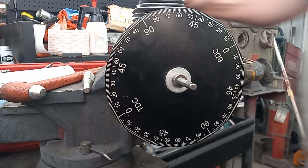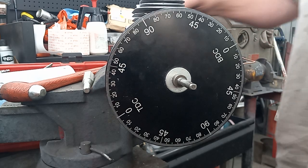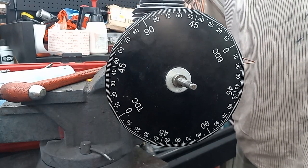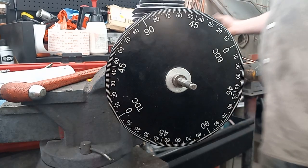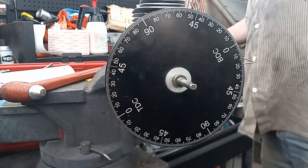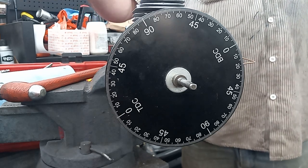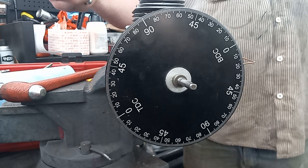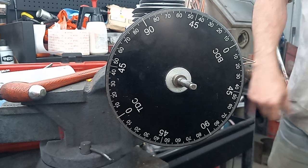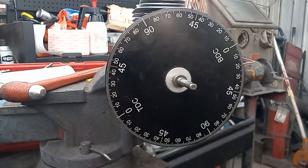But on a wheel, typically I like to look in here and roll the saw all the way down to bottom dead center, because it'll start getting you close. You can use a thread-in piston stop. I know I got some somewhere, they come with these things. Believe it or not, I'll typically use a 5/16 nut driver if I can't find anything, and I'll just put it in here and hold it. But if you're doing it this way, you've got to be careful that you get the same spot every time, or you're going to be chasing. The good way to hit the same spot every time is just one of these. I don't even think this one's the right threads, it goes part way and then binds, but it kind of works so I don't go too far.